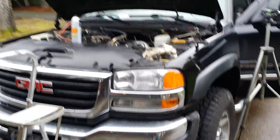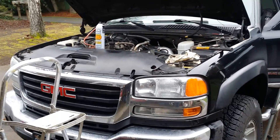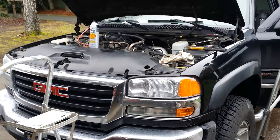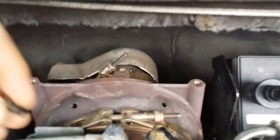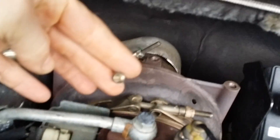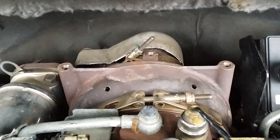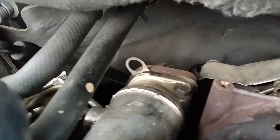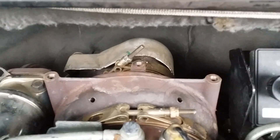I'm going to give you an overview of what I do to clean my sticky vanes on a 2007 GMC Duramax. I have a P003A code. First thing I do is take these little button head plugs out of the two holes that I drilled in the hot side scroll. I should point out that I also have an EGR blocked, so none of this product will go back into the engine.